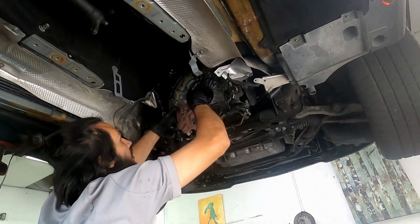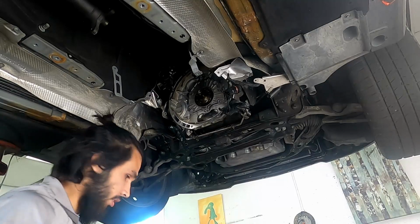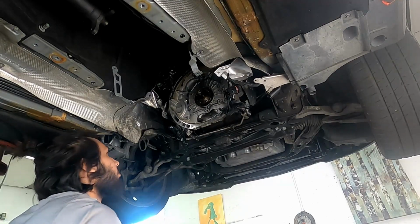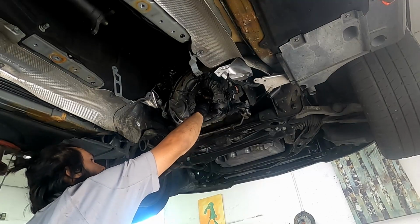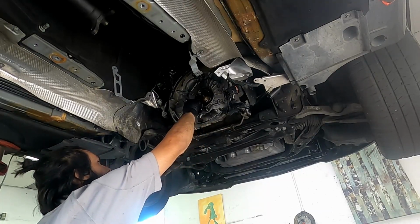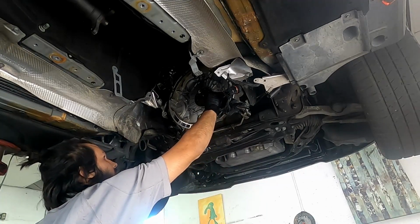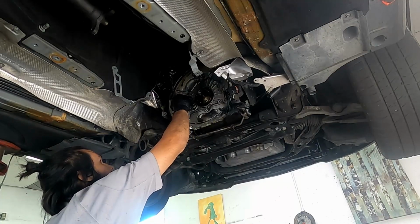So once you thread all the bolts by hand and make sure the hole you're threading is clean, I just go through with them and with the drill and make sure that they hit the end of it, so that I save myself a couple extra seconds per bolt. And I use an extra small 3/8 ratchet to put about 100 inch pounds. Obviously this is not a scientific method of doing it, but